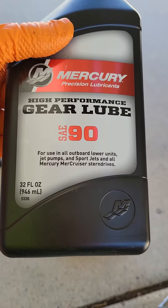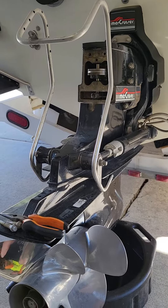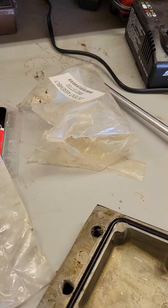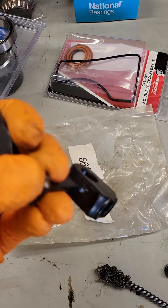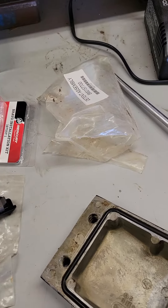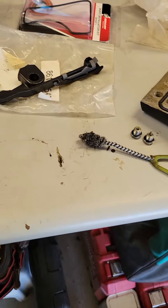When I dropped my gear oil, this is the gear lube I put back in — I put the high-performance gear lube back in. I run my boat a lot so I like to run with the best. I've also run the Quicksilver stuff too, so they're both good. Here's the part number for that. And that little pin there likes to shear, so this is the arm I had to replace in my boat. I grabbed one of those just in case when I pulled my detent ball — if that was bad I was going to go ahead and swap that out too.